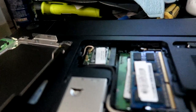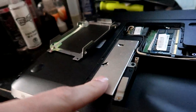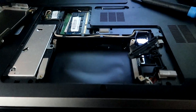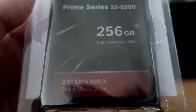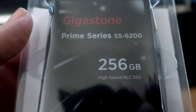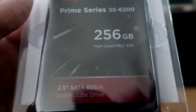Hard drive's out. Looking around under here: there's your Wi-Fi adapter over there, your RAM, hard drive bay. Not quite sure what's underneath this metal plate - looks like it's the DVD-ROM drive. Pull that pin, take it out, and you can put in one of those external hard drives if you cared. But like I said, home theater PC - that's all this is going to be. This SSD is what's going into it. Obviously it won't see full performance because this is SATA 300, not 600. But we should be faster than that 5,400 RPM hard drive.